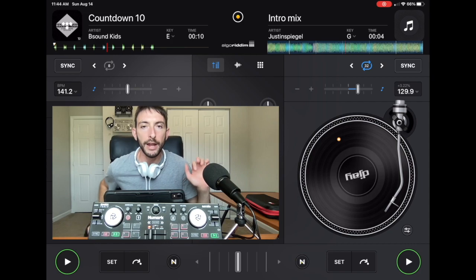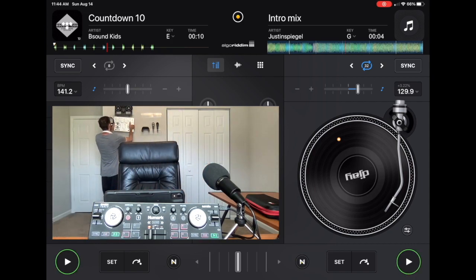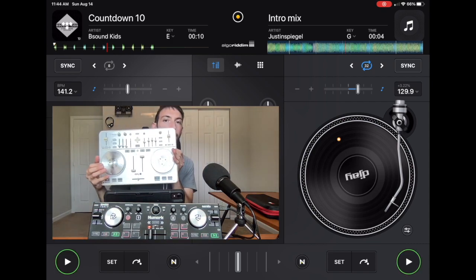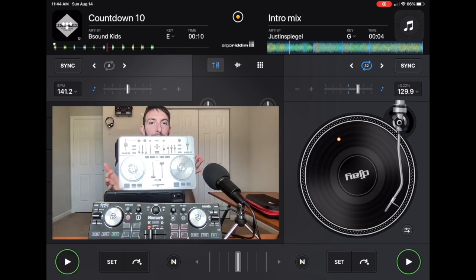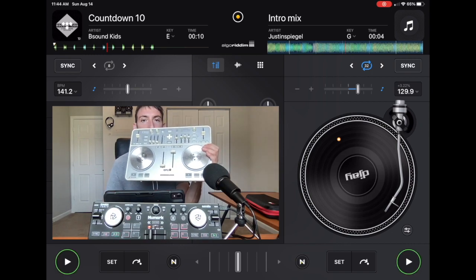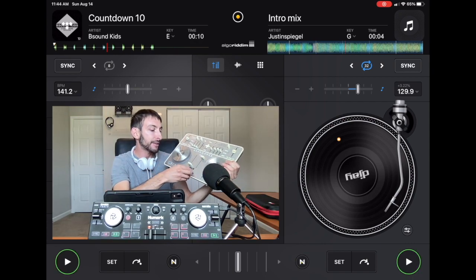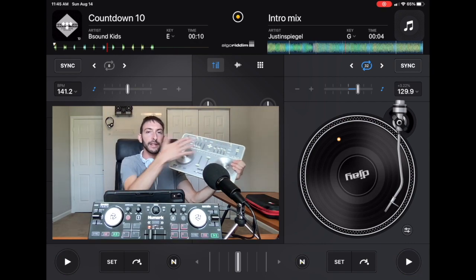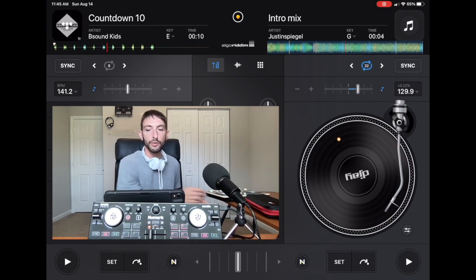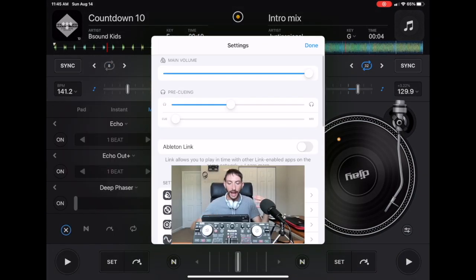So this is an issue that I have with this controller that I got. This is one of the first DJay Pro controllers, and I just had to buy it, but I didn't really look at the pictures closely. And then it had a missing crossfader, like I told you guys. That metal piece is bent, so every time I touch the crossfader, it goes left deck, right deck, left deck, right deck, and it's really annoying. It makes it almost impossible to DJ. So by doing this and just adding that not selected, we have gotten rid of that.